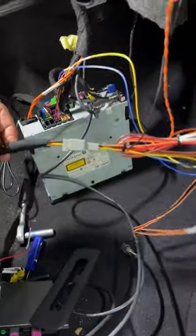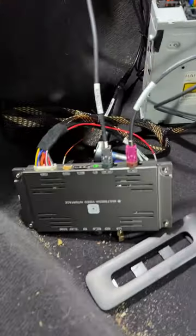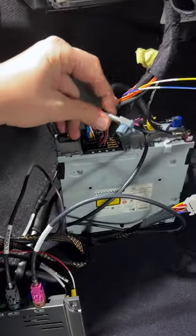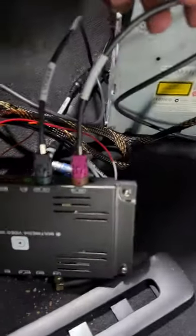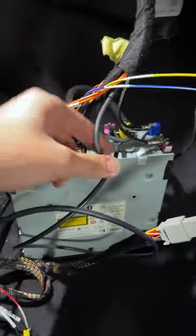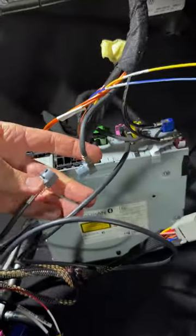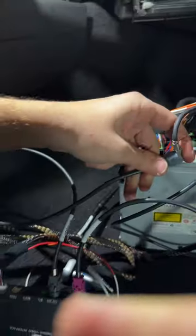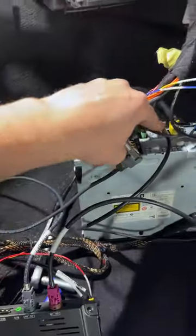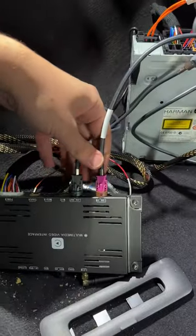This main power cable is connected to the main power harness. After these connections you can start testing. One more thing: LVDS cables — LVDS out. You have to disconnect the original gray video cable from here (LVDS in) and connect it to the head unit LVDS slot. The gray original connector connects with the provided one, so the provided connector goes to LVDS out on the original side, and the female slot of the head unit with the provided wire goes to LVDS in.